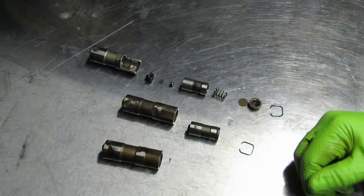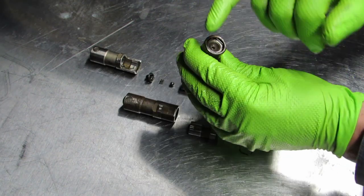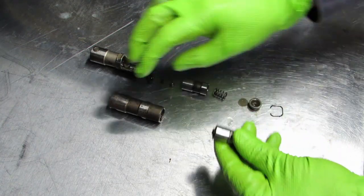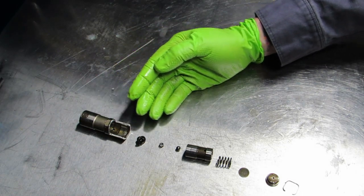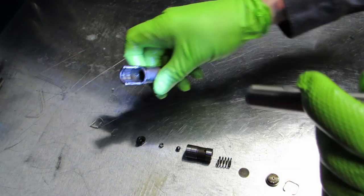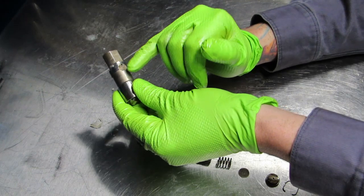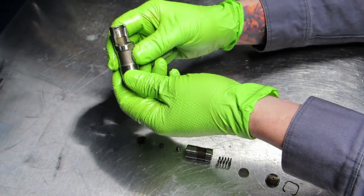Let's look at these parts. I took these tappets apart just to show you exploded views of what's inside a standard tappet. It has a circlip in here that holds the body in, and this body just slides up and down on the internals. There are passageways in here and passageways in the lifter housing itself. Looking at this cutout — I exploded this completely apart to include the outer shell and the inner workings of the tappet. The outer shell rides in the housing of your block. It has a cutout here, and the oil pump pumps up that camshaft galley, feeds into here, and feeds the internals of this setup.